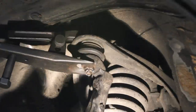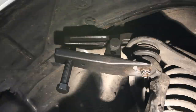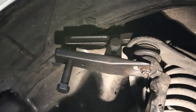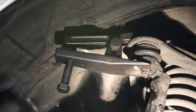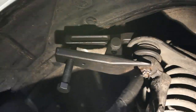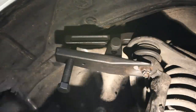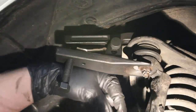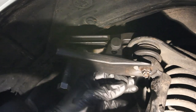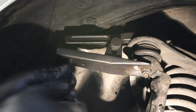We take our ratchet and 19mm socket for the tool, get it on there, and righty-tighten it up real well. You'll notice you'll be able to go ahead and tighten your castle nut because it's not going to spin on you. Now I'm going to come down below and show you another position, show you the stud actually spinning, and show you me using this method to tighten it.